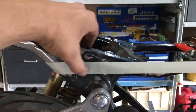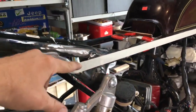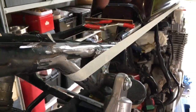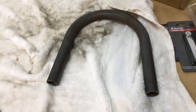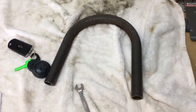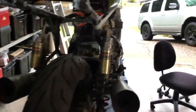I worked out that the bottom of that tape line is kind of where I want to cut — it gives me enough meat here, enough support for this shock. Then the tube is going to go on top and the two pieces of plate, this side and the other side, are going to be welded both sides under that tube, and then I'll get a hoop. I actually purchased one from eBay but it's out of whack, it's not right — not the size I need. I changed my design; I was originally going to make it out of 25mm thick stuff, but now I've decided to make it out of 21mm tube.